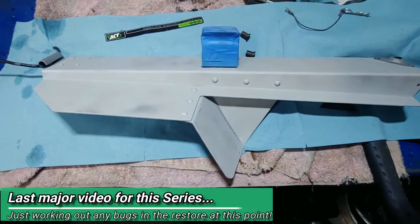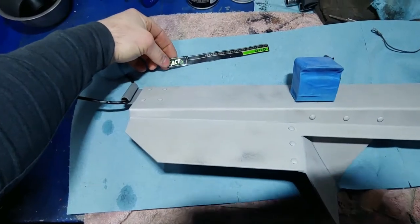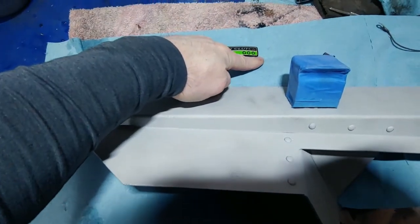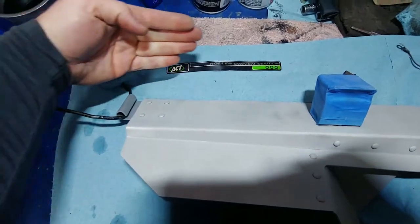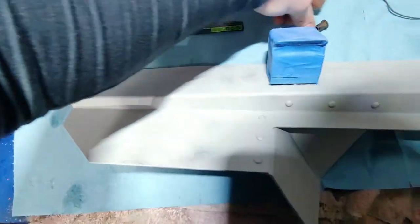These are the last few steps. I am working on the belt cover. I ended up taking the only sticker that was on it off. I heated it up with a heat gun and then used a real nice sharp razor, slowly running it underneath with the air blowing across this way once it was heated up well. That did pretty good. These are just the bushings that come out of the end here for the hinge.